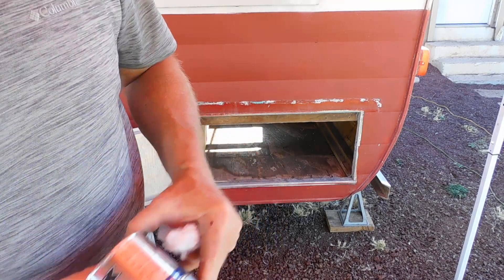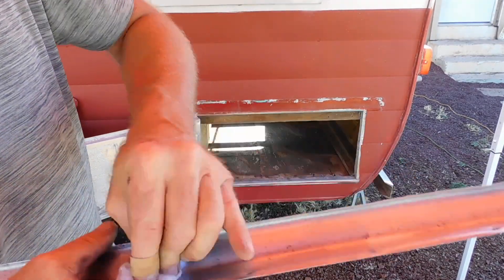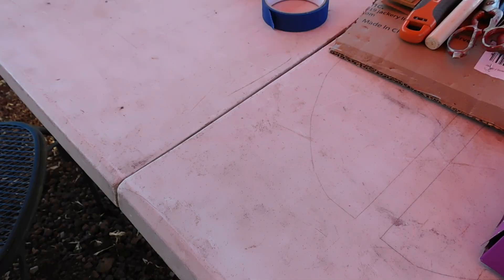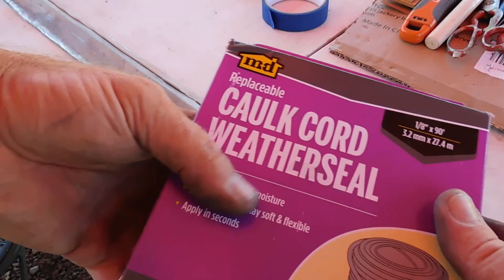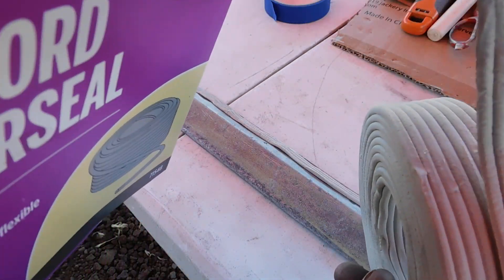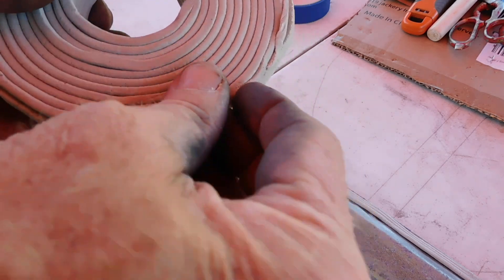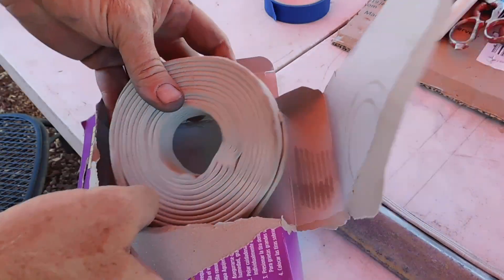Just a little wad — see how this is perfectly clean and white right now? I start rubbing it on there and it oxidizes instantly. We've added our old-school weather stripping to the back of our eyebrow here. Anyone who's ever used this before knows it's just kind of pasty and malleable — it never hardens up. This roll will go a long way. You can peel it down and strip it to two or three little ropes so we don't waste any. Even this section right there, if you're gentle with it, you can rework it. It should do this whole trailer, no problem.